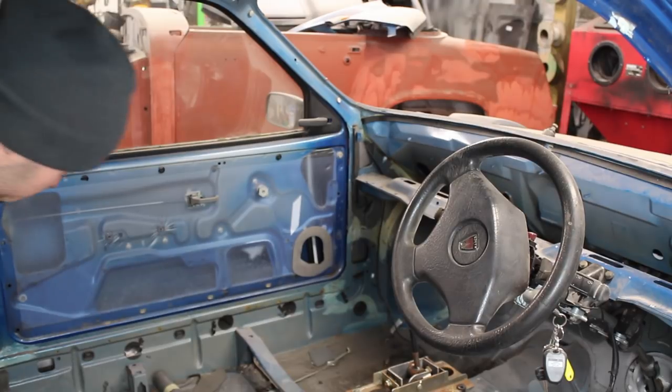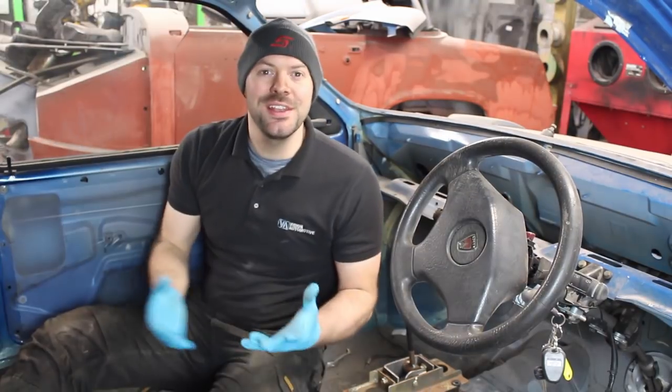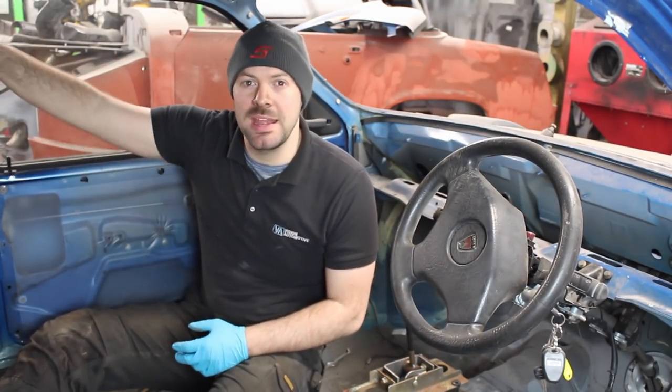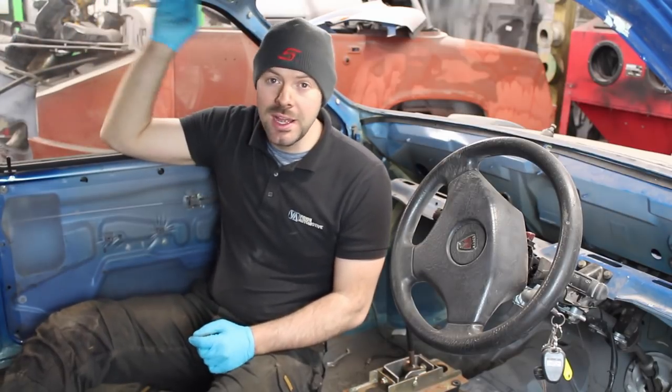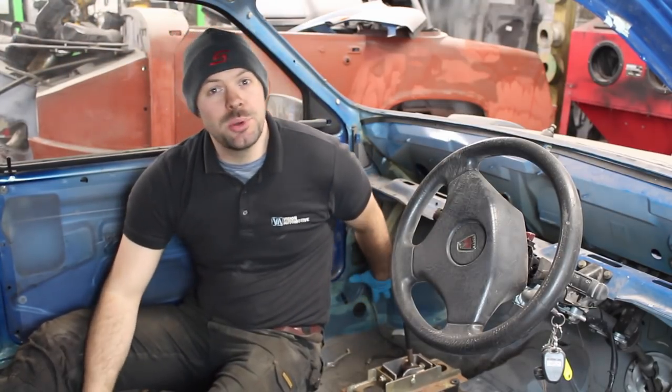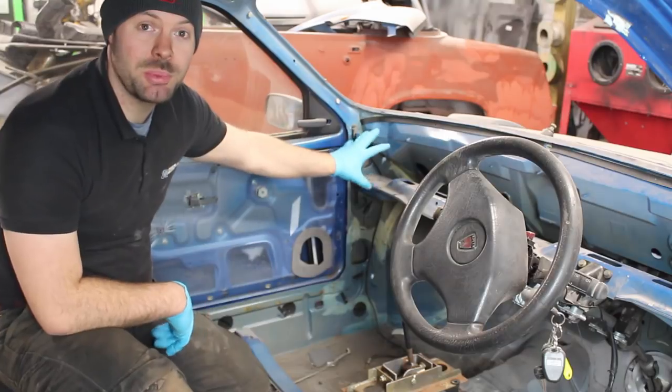Squeezing in and around this little car could get tiresome. The front leg of my roll cage needs to join the main hoop in the centre of its curve, follow the roof line above the door, come down the windscreen pillar and then meet the floor at the bottom of the A-post. It's going to have to miss this cross brace and I'm probably going to have to modify the scuttle where it's recessed for the bonnet hinges.